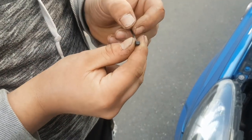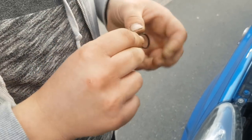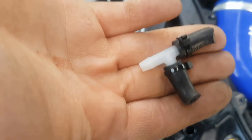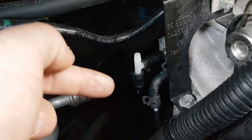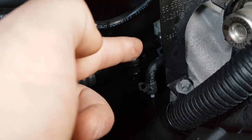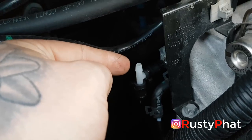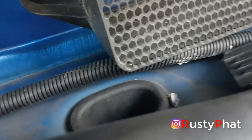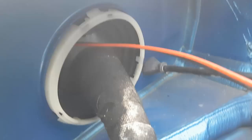We're just going to tie up the black pipes to make sure they don't come off - we don't want any little accidents. We've put the T-piece back in as you can see here, we've cable-tied it so it's all nice and secure. We've left this end off because this is where the vacuum pipe is going to go to the interior, to our boost gauge. To do that we're going to feed it around the back, put a tie wrap here, then feed it up through the drainage for water. That's going to go through the grommet down here.